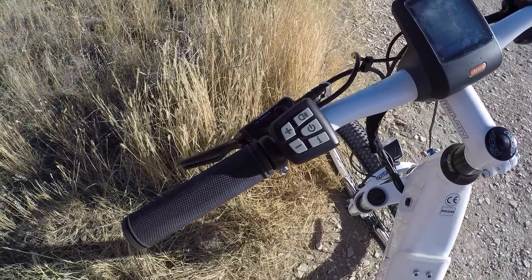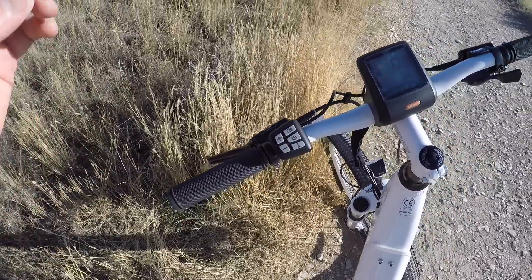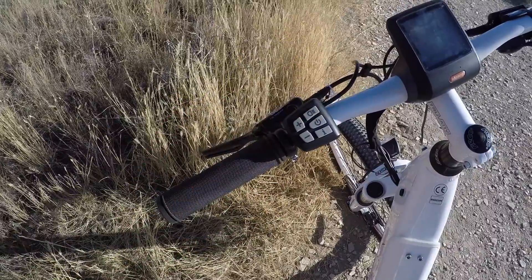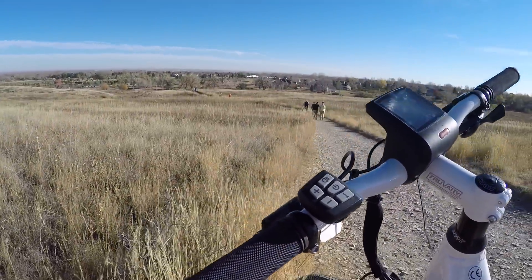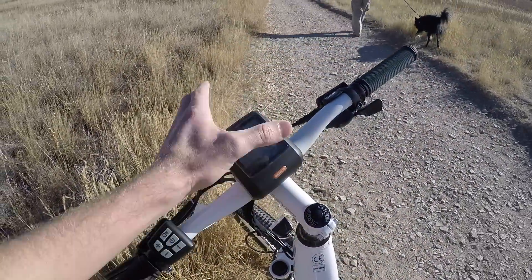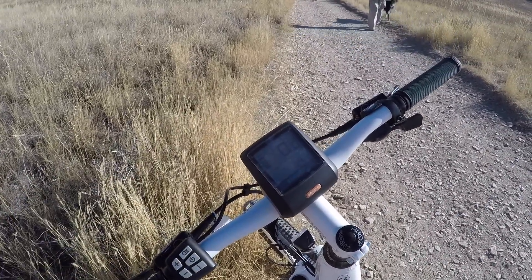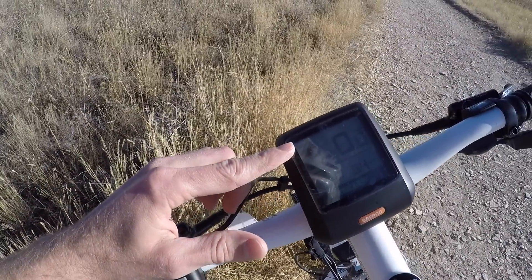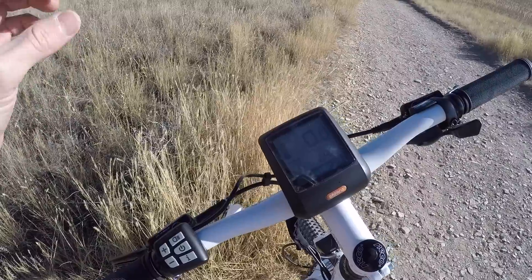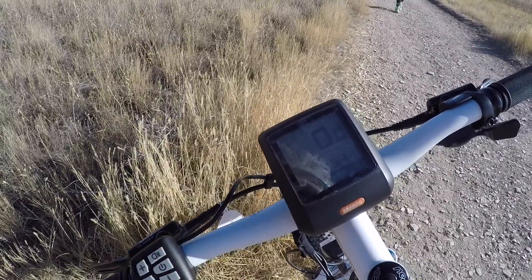You can see over here we've got a five-button control pad, and that gives you a lot more freedom. It means they're able to make those menus a little bit quicker with fewer steps. And because this is rubberized, not plastic, I think it's going to be pretty durable in terms of water and even if you crash. The display panel, however, even though it angles forward and backwards, is not removable — so that might be a point of concern if you're a mountain biker. Once it's powered on, you've got 10 increments in the battery indicator, which I really appreciate because four or five increments just isn't enough. You lose 25 or 20% of your battery versus 10% — this gives you a much better idea of how far you can go.